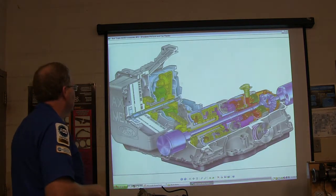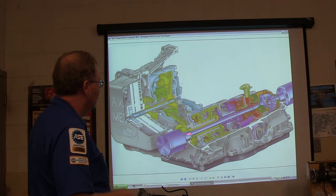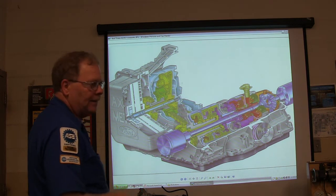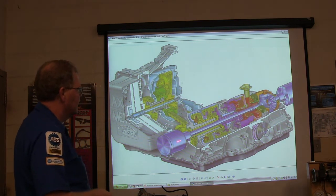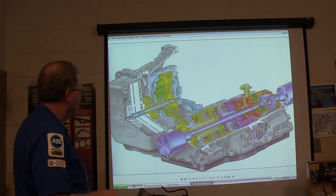This is another front-wheel drive transaxle that actually has CV axles in it — see how they're snapped in there? The CV joints are out on these ends. They snap into the spider gears.